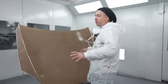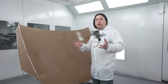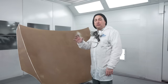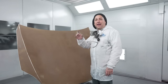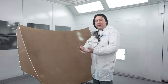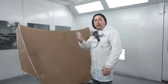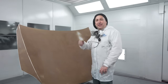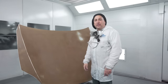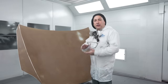We've got everything sanded, prepped, and cleaned. I wanted to talk about the sealer — you guys know I always talk about sealing the new factory e-coat for best adhesion and best holdout on your paint job. One crucial thing to a nice flat paint job is getting your sealer down flat. If you don't, you'll be fighting it all the way up and trying to pound on the clear coat to get a flat finish because you have a lumpy or bumpy sealer. I like to use a premium gun — we're using the LPH 400 from Iwata — to get a nice flat foundation.